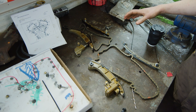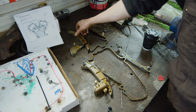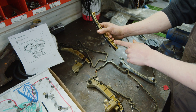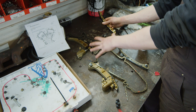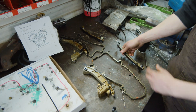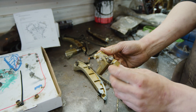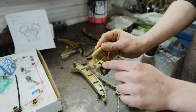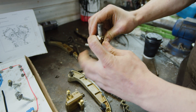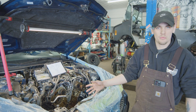With your timing chains, you always want to make sure they're laid out the same way you took them off, so you always know how to put it back together. So up here, this would be our left bank. On them they are labeled, but sometimes with timing jobs they aren't — so this one would be our left guide. This one should say right and right, so we know where they go. With our tensioners, you're going to have to use a simple thumbtack. I know that sounds crazy if you haven't done timing before, but that's just how we lock it out. There's a little clip here — it slides in and holds into place so it doesn't come out. When you're taking them off, you have to push this clip down, and then you're able to push it back in. This one was broken so I didn't lock it out. Now we have all the chains removed and ready to go.